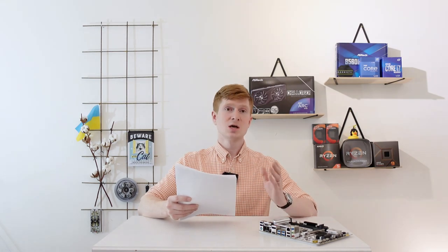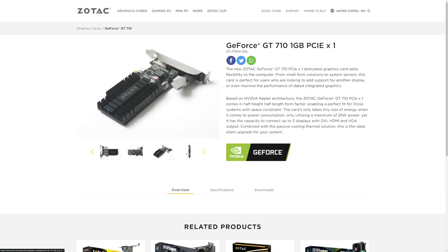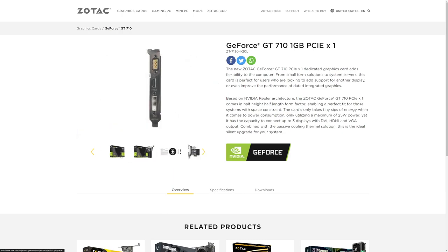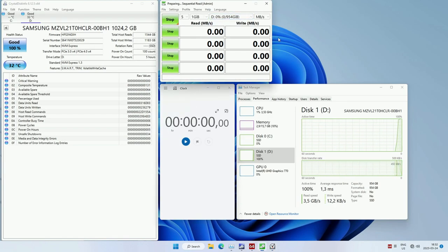I have a special NVIDIA GT710 graphics card that uses a PCIe x1 interface, and unfortunately the power delivery in the x1 slot is not enough to power it up. Nevertheless, simpler devices such as Wi-Fi adapters or M.2 SSD adapters work with no issues — so this is not a big problem, just something you need to know.